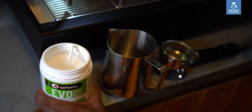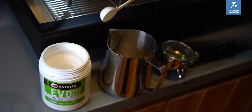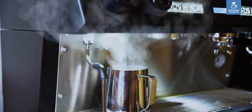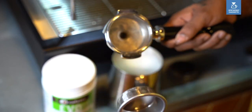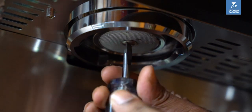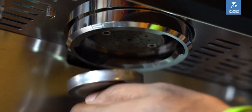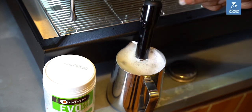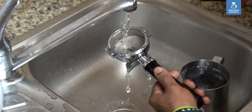At the end of the day, take a bowl and add espresso cleaner powder, fill with hot water and mix well. Remove the portafilters and separate the baskets from the portafilters. Remove the shower screens and shower screen screws. Put everything in the bowl and let it soak for 20 minutes. Then take out the parts, clean all parts with a group head brush, and rinse with clean water.